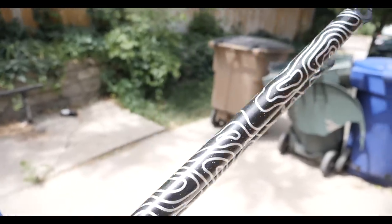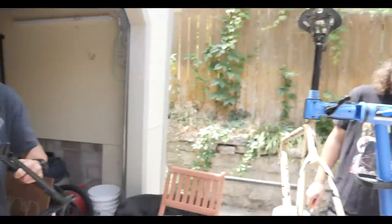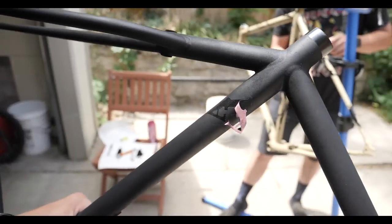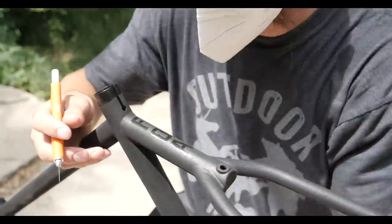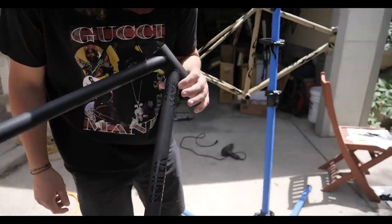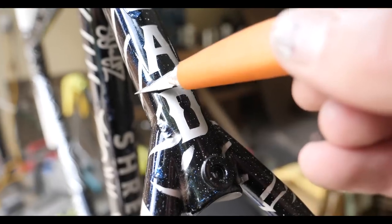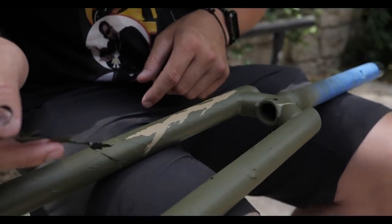Not as noticeable in the dark garage as it is out here. How's it looking, Wes? Real dusty — I'm handling it. I need to sand it with parchment paper. Did you pull that sticker off yesterday? It's gonna be way visible. All right, I'm gonna start doing my blue flake gloss. Look at this, it looks so good — bad drips though. The sparkles — that does look really good. Blow dry the frame after it dries so the stickers are all soft — that works really good. Parchment paper, which you can get at your local grocery store, is an alternative to wet sanding. You do have to be careful when you use it because Wes ended up sanding through some of his matte paint. Is it working? Kind of knocks down the dust. The stencils are coming out good though, most of them doing really good. Finishing touches.